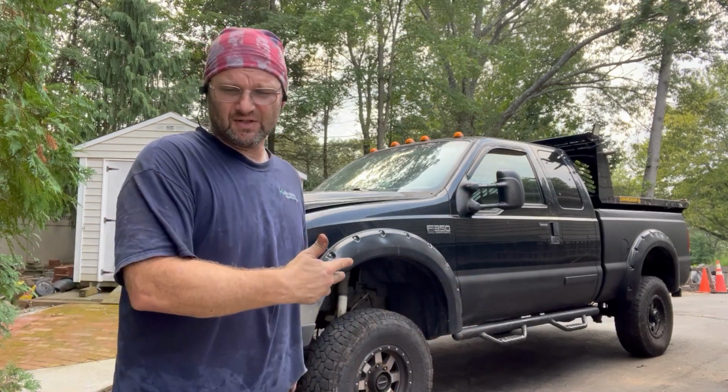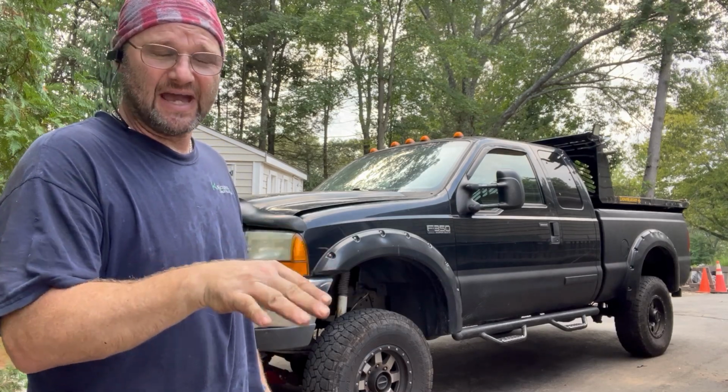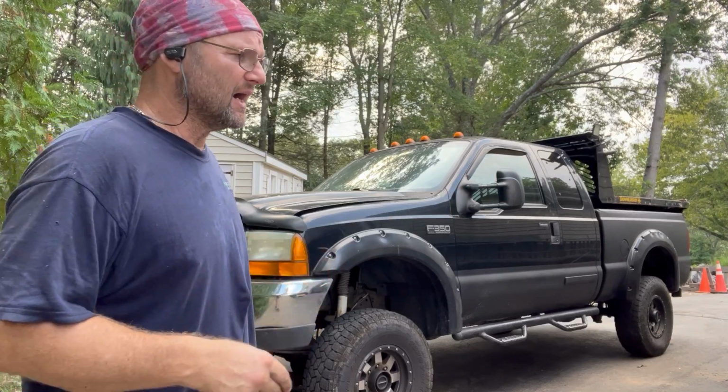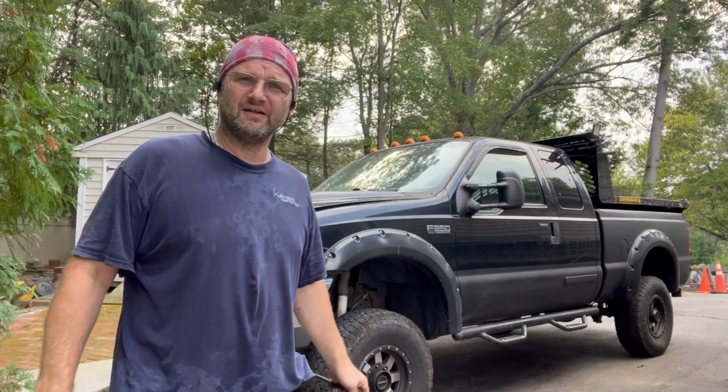But anyways, truck works. The emergency brake holds when it's in neutral. When I put it in drive, it kind of creeps if I give it gas. If I put it in reverse, they stay unless I give it gas, then it creeps. So I'm gonna leave it like that for a couple days and use the truck to get them cycled in. And then before I put the truck camper on it, I will jack it up and readjust them, get them a little tighter, so that way there's no movement at all. Other than that though, I consider it a success.